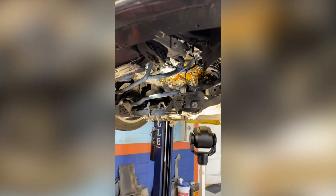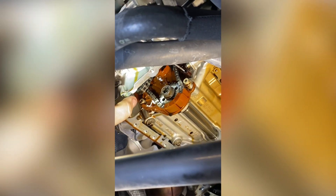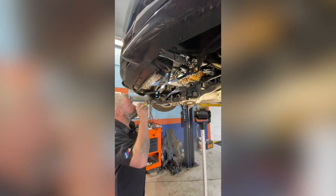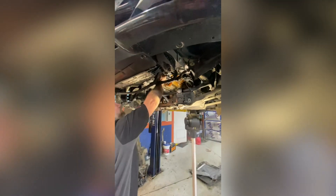Back at it again — we have removed the central bolt, the front hub is loose. We've got the oil pump chain tensioner loose and it is pinned. It is time to pull off the front hub so we can disconnect this and then go up top. I've already removed the dowels from the guide rails and then we're ready to basically pull up the timing chain set.